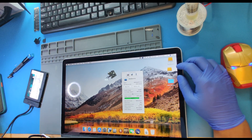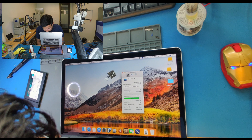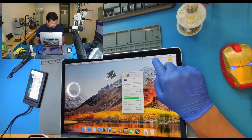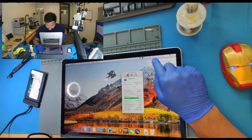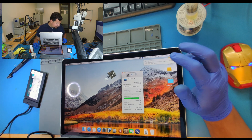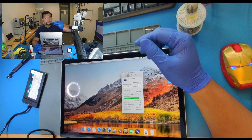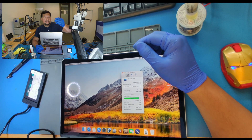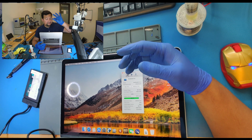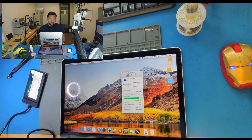Now it's charging at 50.12W. I'm just going to wait for the battery to go to at least 1%. If it goes to 1%, the computer is done and it's going to be fine. I have 0.8% here and 1% here, so if I disconnect it, it will stay on at least for a second — meaning the SMC is working and my only problem was my MagSafe. That's why it's so important, guys — test everything, visually check your board. My name is Juan and this is Engineering Rummack Services, see you next time.